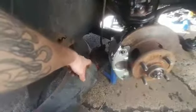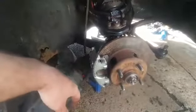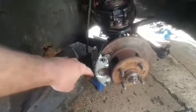But you have to get everything. I think 76 or 77 had a smaller diameter rotor and even a different caliper — that was smaller. I know the rotor was smaller in diameter, so something to watch out for there. If you have an early, early car, you'll also have to do the later rotors. So this is a little bit more involved.